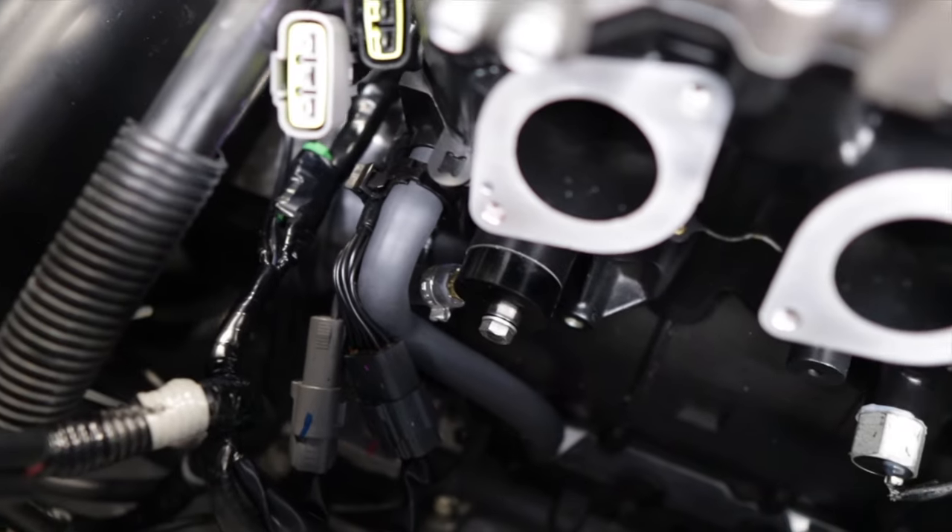Now all of the water lines around the engine are 100% complete. You only have to run one more water line, and this is probably one of the more difficult ones to do because we have to drill a hole in the back of the pump, modify the pump, and then run a water line from all the way in the back of the ski to the front to supply water to the intercooler. To start on this, we're going to have to remove the pump and also remove the stock exhaust block-off plate to make for easy access drilling the hole and then adding the fitting once the hole is drilled. It's not too difficult, it's just another one of those tedious things that will take a little bit of time.